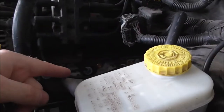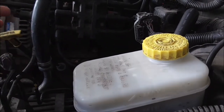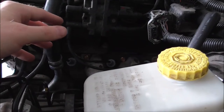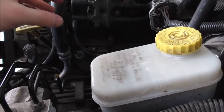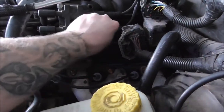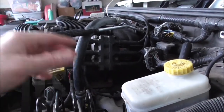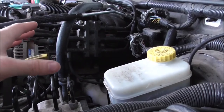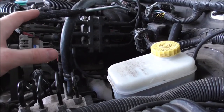First thing I did was take one spark plug out and check the gap — it was fine, which I'd already checked ahead of time. Then I pulled these two wire boots off to see if they were loose, and they were tight. I went around and double-checked, pushed all the boots in and pushed the connectors all the way. Nothing changed. After starting it a few times, it still had the misfire.